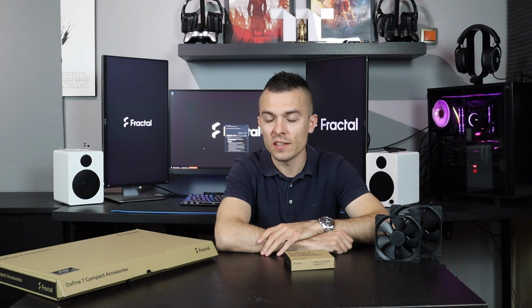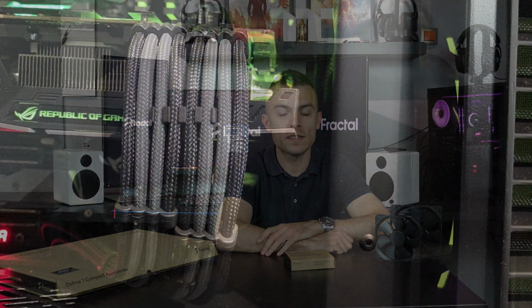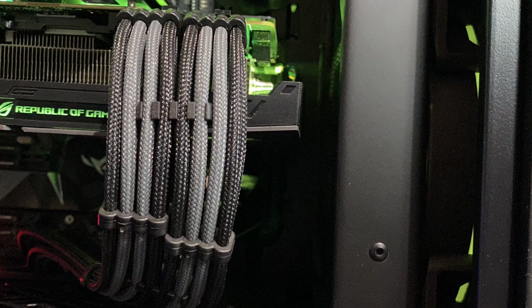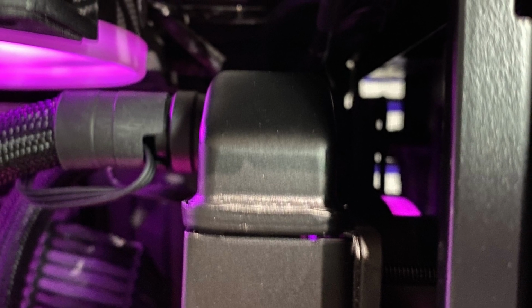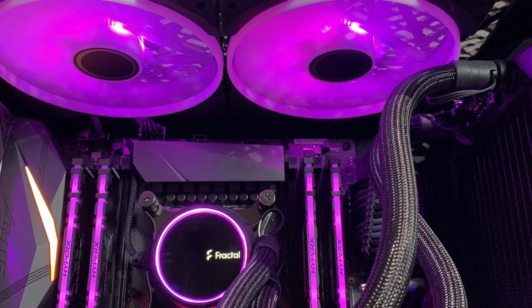But if you decide to place a radiator on the front and go with a 360 radiator or 280 radiator, the graphics card can go up to 305 millimeters. In my situation, I placed the GTX 1080 Ti Strix model, and it fits just perfectly. You even have 1.5 centimeters of room between the front radiator and the fans, which still has enough space to get a great intake.